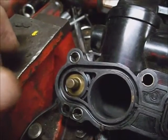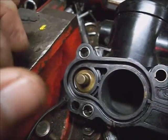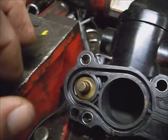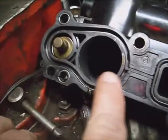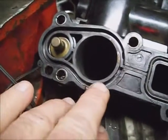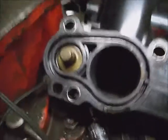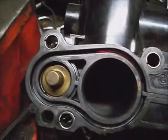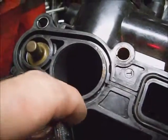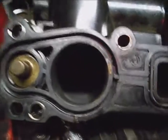I'll probably pick the center out of the radiator cap and go in through one of the vent holes, then put a small gash underneath the metal washer — it's in there with the spring on it — to let excess pressure vent out of the system. It should offer some restriction, but if pressure gets too high it'll vent out through the side of the radiator cap, inside the blue cap, and that should alleviate this problem.